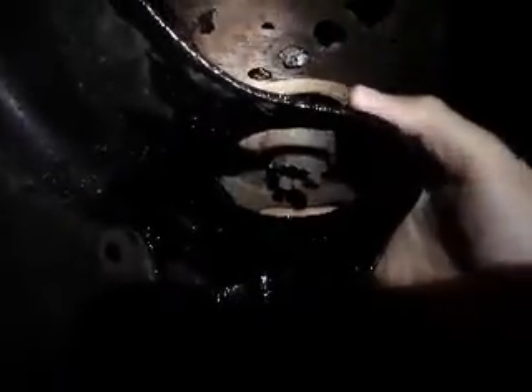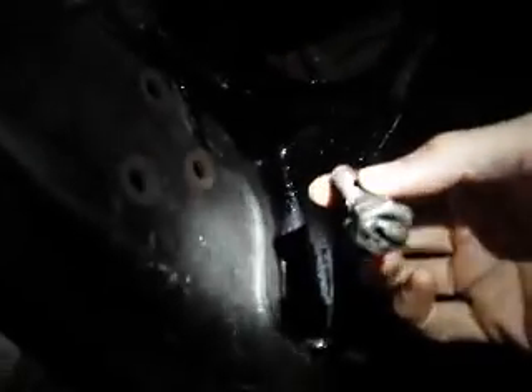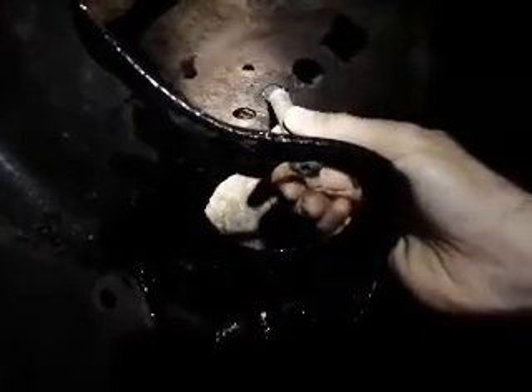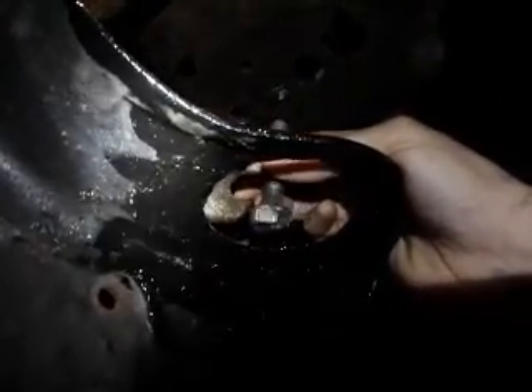What'll be left is your metal top hat with the bolt sticking through it some amount, and maybe you'll be able to finagle it out from under the remaining bolt. Or, now that the rubber is out of the way, cut that bolt — leaving as much of the bolt as you can. Why? Because I was able to weld a nut onto the remaining part of the bolt sticking out of the cab, and they all came out. No matter how horribly corroded they looked, by welding a nut on I was able to back them all out with my impact wrench.